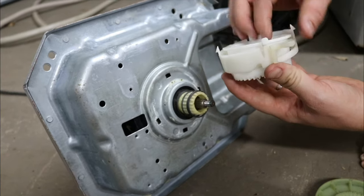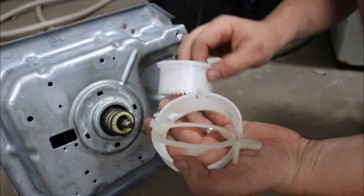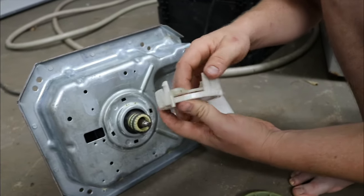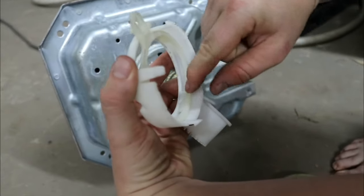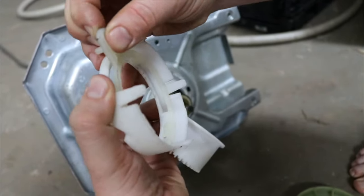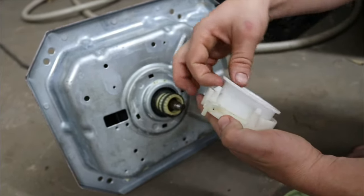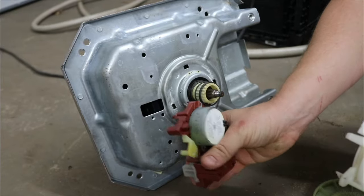This will get sand all in it because it's sitting on the very bottom. So if you clean out these three parts — and it's not hard to get messed up, don't take them apart or you'll never figure out how to get back together — the little arm goes just like this and slides back and forth, so that's easy to figure out where it goes again. See these little ramps going up? It's just sliding and ramping up. Those will get sand in them. I like to use white lithium grease after I clean it out — just spray it all the way around, make it nice and move real easy. Drop this back in, make sure this rim doesn't have sand in it, and snap everything right back together. Then you'll put your actuator back on.